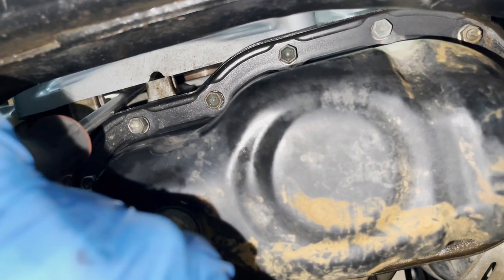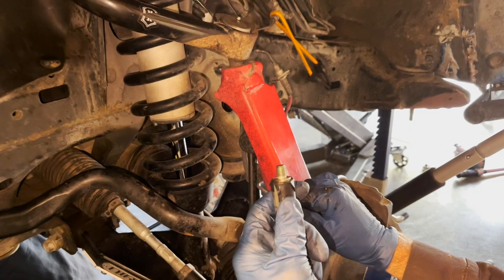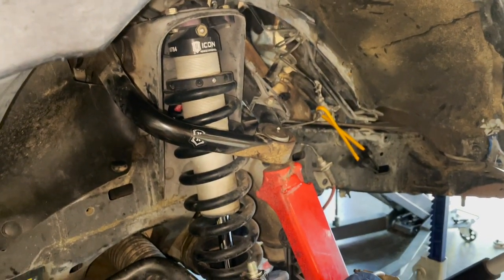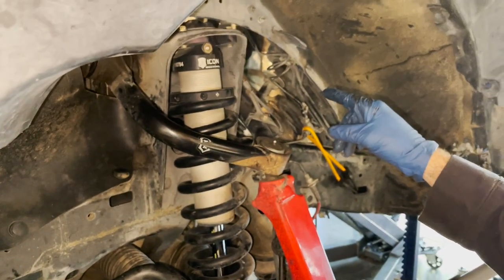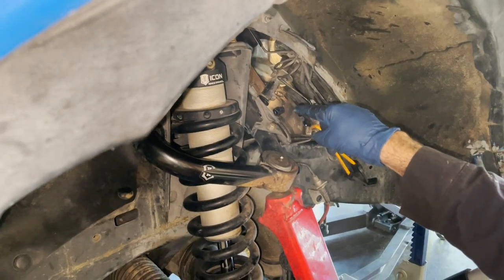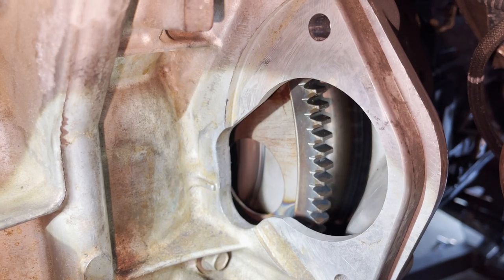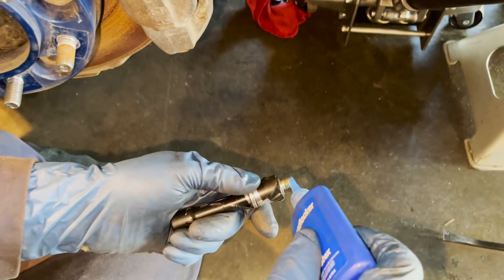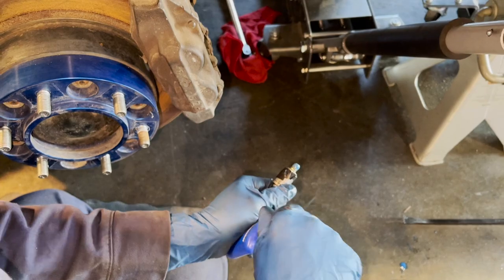This is the access hatch - it's blocked by a little plastic cover with just a couple clips. I wedged the screwdriver in here, pushed the tip through one of the big holes in the flex plate, got the tip against the torque converter, and rocked the screwdriver a little bit. With a person looking in from the wheel well, they told me when we got the alignment. One of the six bolts is black - you put the black one in first so when you run out of bolts you know you're done. We're choosing to put a little blue 242 Loctite on for extra insurance.